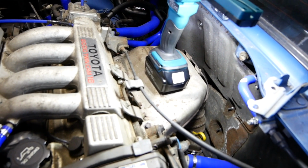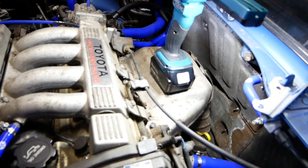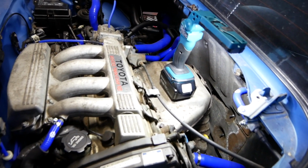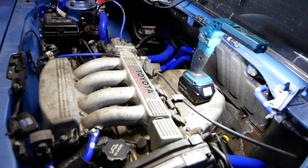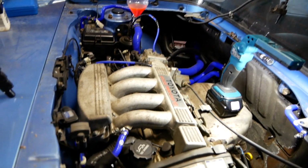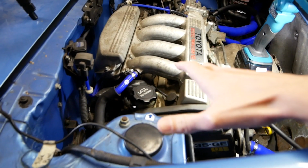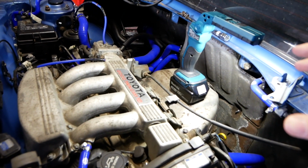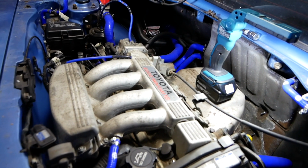I'm hoping it's just a big airlock that I'm struggling to clear out, but the other option is the thermostat that I bought was dead on arrival and needs replacing, which would really suck. I've tried back end up, I've tried level, I've tried front end up, I've even tried raising this back right hand corner to get any air out of it, or lowering that back corner and raising the other one, I can't remember.